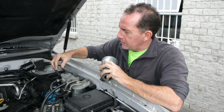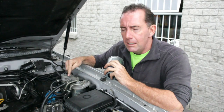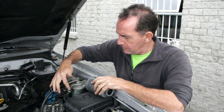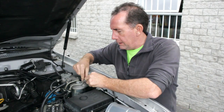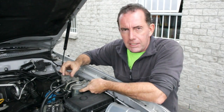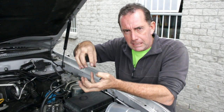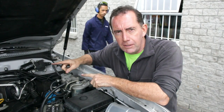Once that's tight, you have to prime it. This is the primer button here — it sucks fuel into the system. But before priming, I want to make sure I've got clean fuel coming in, so I would also change the secondary filter. This secondary filter is different — you'll need to remove the two pipes and take the housing out. At the bottom of this filter there's one bolt; loosen it and the outer housing comes off, revealing an element inside that's what you replace.